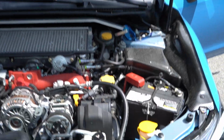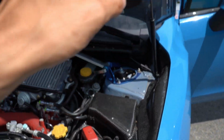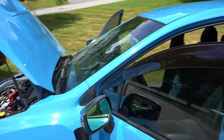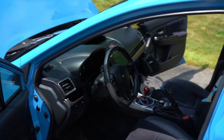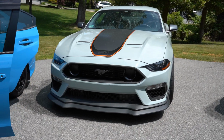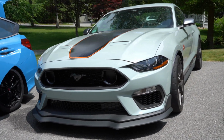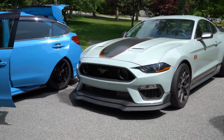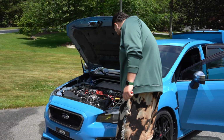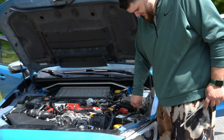All right, guys, so we're gonna start tackling away here. First step is obviously to disconnect the battery because of the airbag. We don't want anything catastrophic happening. So we'll disconnect the battery, make sure there's no voltage going through the car, and we can start taking the OEM wheel out. It is gonna reset everything, but that's all right. You're about to have a clean wheel, kid.